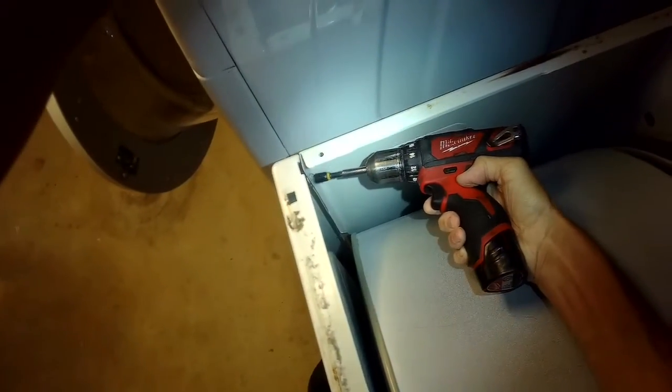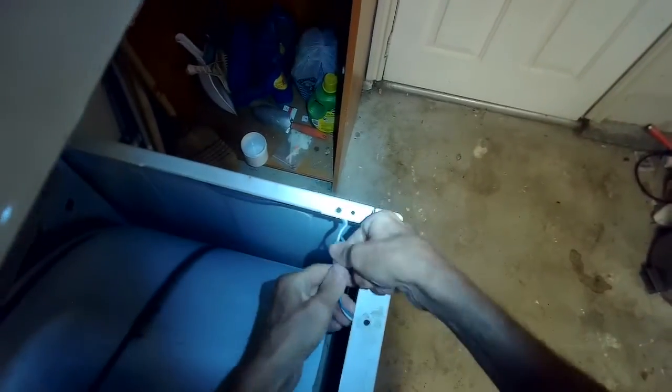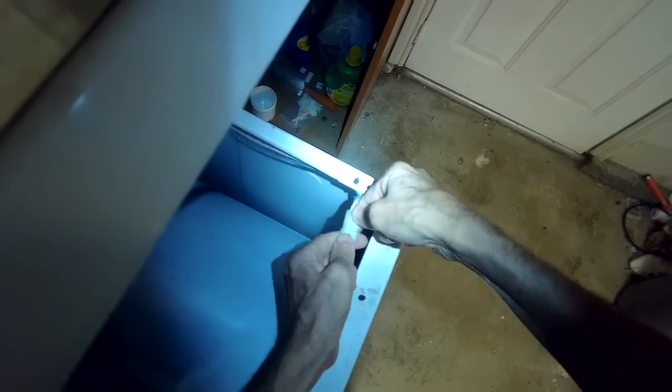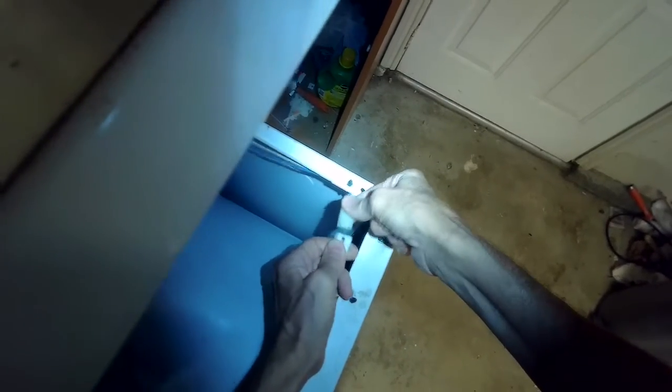But here's that little thing that you would push the screwdriver into or the paint scraper to release it. Once you release it, you take this, which is a 7/16 socket, and you undo a couple of screws here. That's about all it takes to remove the front panel. You do want to take off this connection here, which is for the door switch, and this one came loose, but sometimes you have to put something in there like a small flat blade screwdriver to pry that out. Let's come apart. One more screw to take out here.